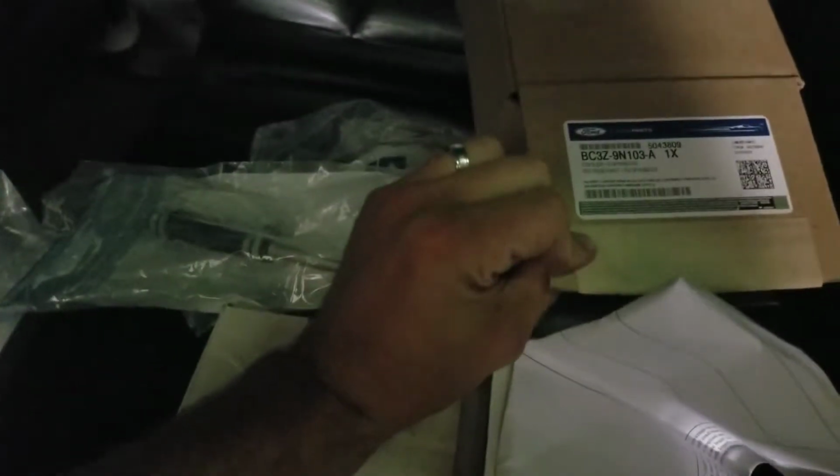This is the coolant line for the turbo and the fitting, because I'm going to replace those. Those are common fail points. And then this is the oil line for the turbo as well, or vice versa. This here is a new fuel cooler. I'm going to replace that as well. Don't want to take any chances on any metal that was in anything else. This right here is a vacuum pump gasket that those always go out, but I'm pretty sure you have to remove the vacuum pump to get the CP4 out.